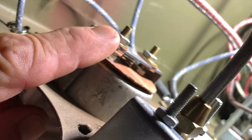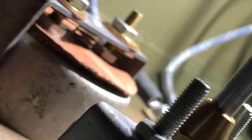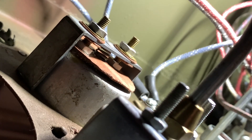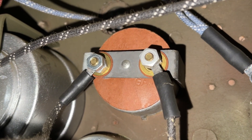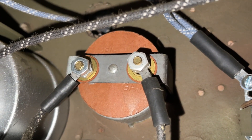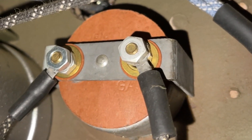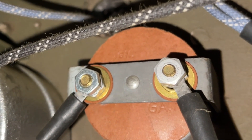I've installed the gauge just like I showed you in the beginning of the video. I've only tightened those nuts down just so they get a good bite on the back side of the dash — you don't want to tighten it down too far because you'll ruin the ground and bend the bracket. Where those two brackets touch the dash, there should be some paint removed and sanded away. Right where that red arrow is pointing on the back of the dash, that's where you want to scuff a little bit. Now we'll attach the short wire to the terminal marked IGN, and the long wire from our sending unit will attach to the GA side. The connector from the wire goes on the stud first, then the lock washer, then the nut. Use two wrenches — one to hold the nut we installed the bracket with, and the other to tighten the nut to the wire.